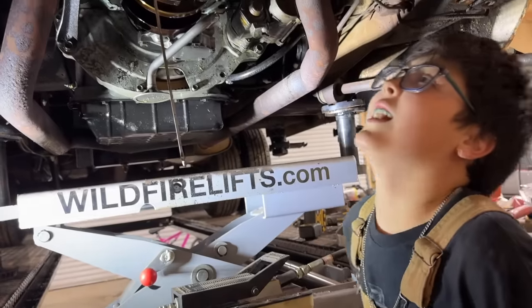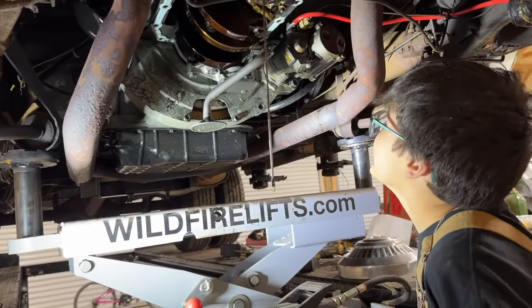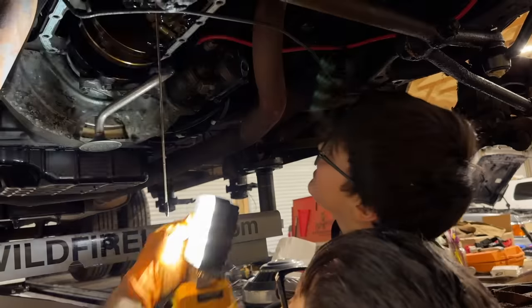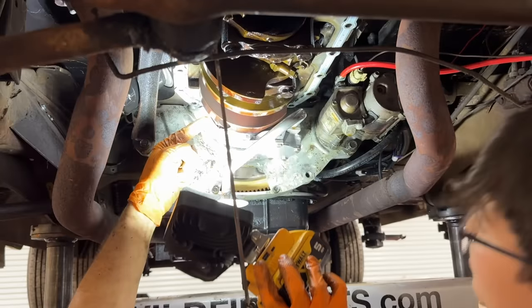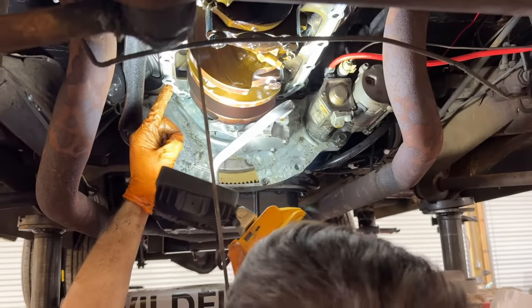We had good oil pressure and everything, so I'm not really worried about bearings or anything. I mean, it looks fine. Nothing looks out of place. No. Because right in here is where I kept seeing it. See, our rear main seal's underneath this cap, you know. Oh. Look at our crosshatch. It looks very nice. See it on the bottom? Oh, yeah. Looks really nice still.